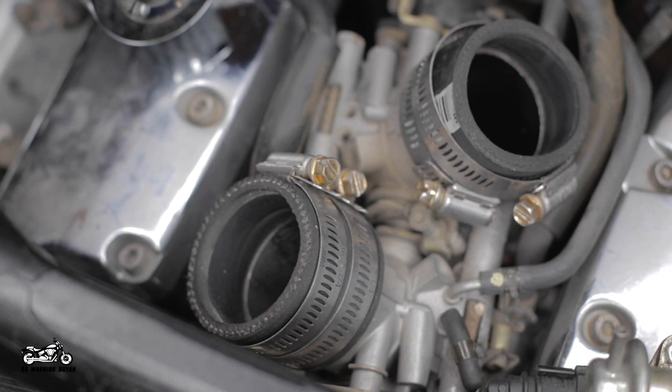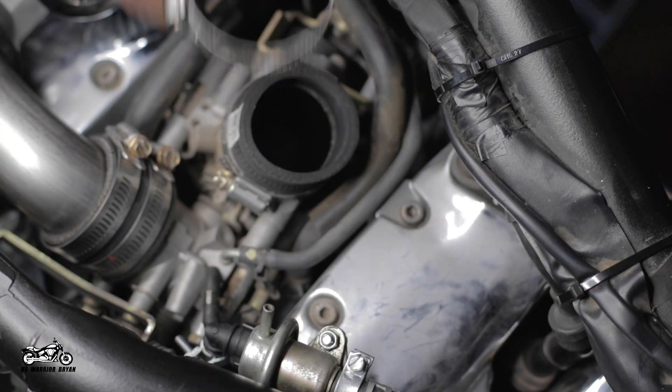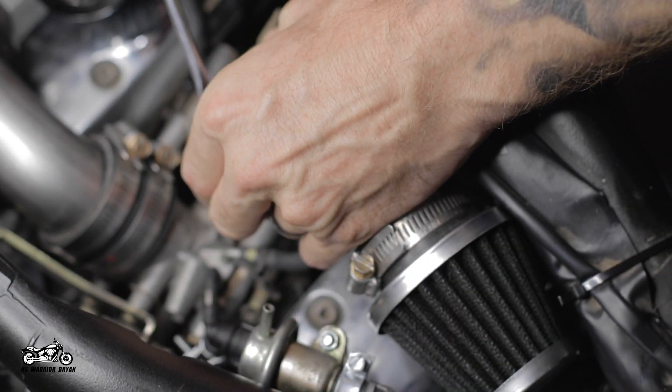Cutting your own stacks will take some trial and error to get them cut where everything sits just right. I'd start long and take off little by little until I got it to the right angle and length. Always be sure to use compressed air and blow them out — you definitely don't want any metal shavings falling into the throttle bodies as you're trying to fit these into place. If you're cutting your own stacks, fit the 2-inch tubes over the throttle bodies and make sure they're seated all the way, then clamp these into place and secure with an adjustable hose clamp. If you decide you don't want stacks, you can take your filters and connect them directly to the throttle bodies, and that will just make a big air kit instead of a velocity big air kit. If you're making your own stacks and have cut them down to where you're happy with how everything is sitting, take your filters and connect them to the top of the stacks and secure with the clamp. You can then insert the other end into the hoses already connected to the throttle bodies, rotate them into place until you're happy, and use another clamp to connect the stacks to the hose and tighten into place.